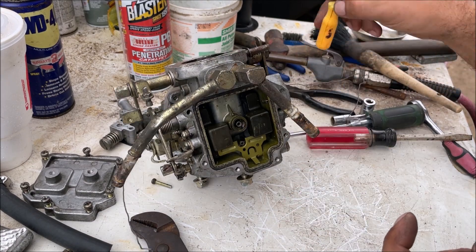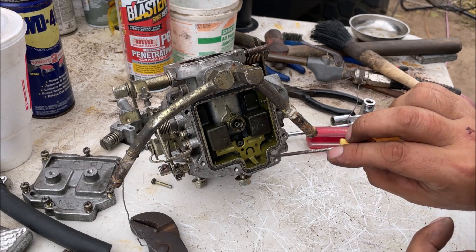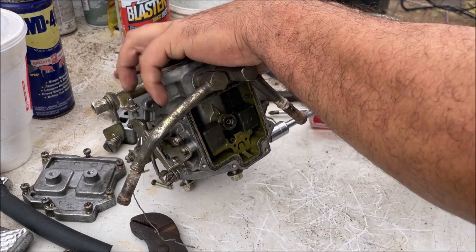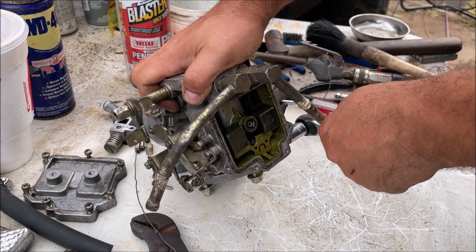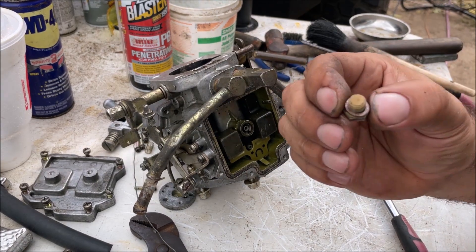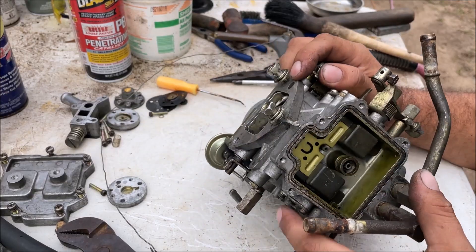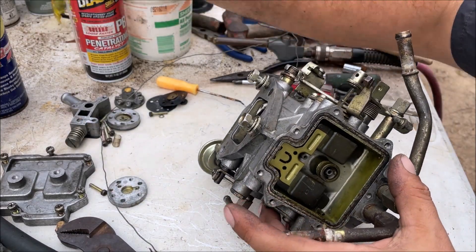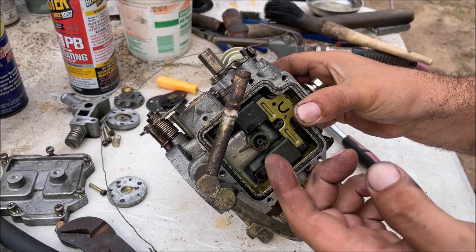This other port is getting the vacuum signal from the center inside of the carburetor, and this is also where it's going to inject fuel when vacuum drops - we'll look at that in a bit. The fuel bowl is on the bottom of the carburetor. It has some cutouts for float drop and to collect trash - you could say that's a good thing. They said these came off a running car, but the needle in the seat is stuck on this one too.